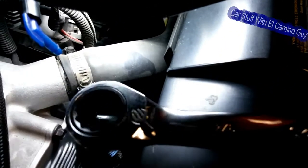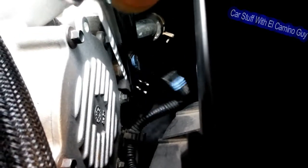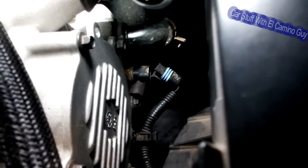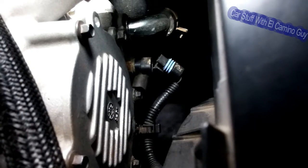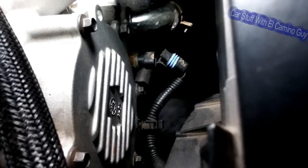What's really handy is that I happen to have a 7/8 ratcheting box-end wrench, and that's going to let me get the sensor off a lot easier. Two things I'm going to do before I even touch this: one, disconnect the sensor — you can see I have the wire loose here — and then I'm going to put a catch bucket because I know I'm going to lose some coolant, and a rag just in case so we don't get any coolant over on the distributor — the Opti-Spark. You know: lefty loosey, righty tighty. No magic here, but let's do it.